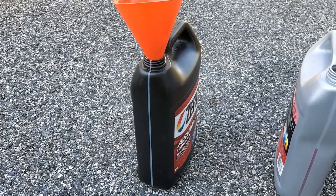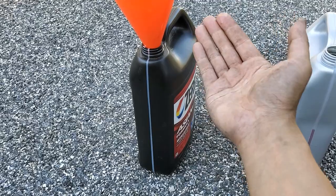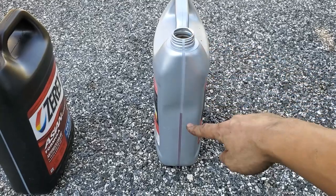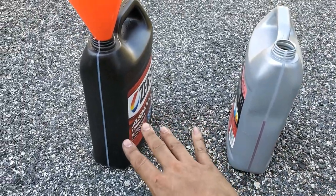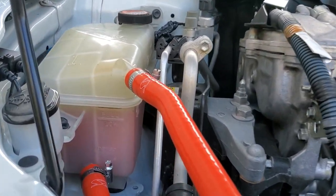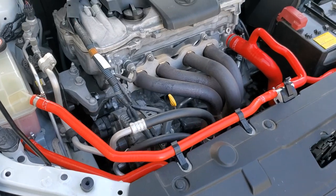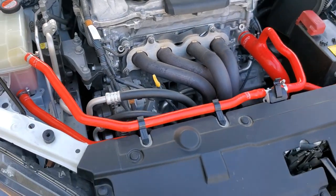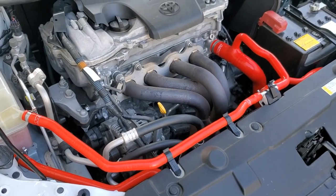If you're a little unsure about the amount of fluid that you've put back into your system, you can empty out the pan into the old container, and you should basically have the same amount of fluid that you put in come back out. I just got back from my drive, I let the engine cool down a little bit, and it looks like the coolant level is about the same, so the air should be out of the system. Just to be on the safe side, I'm going to keep the extra coolant in the trunk along with the funnel, and then periodically check on this for the next day or two just to make sure it doesn't go down anymore. I hope this helps you out if you're thinking about getting some HPS radiator hoses for your car. Thanks for watching.